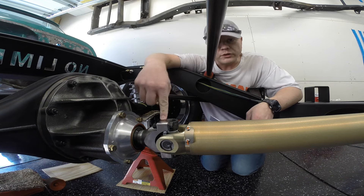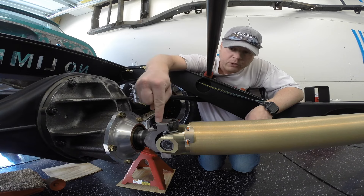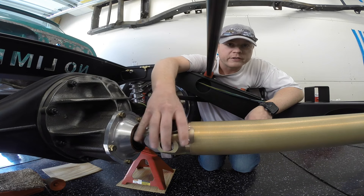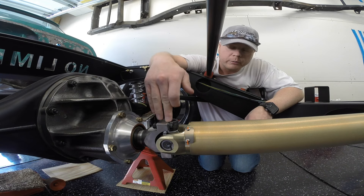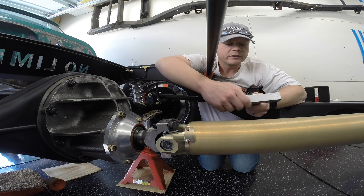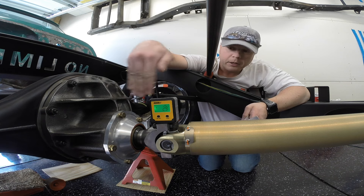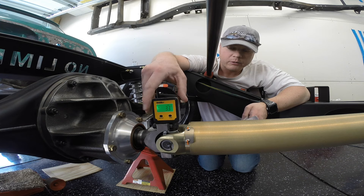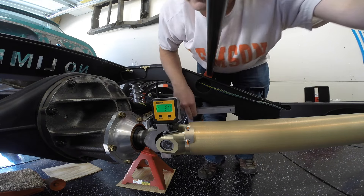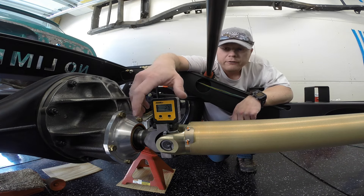The third angle is the angle of the pinion. I've got the driveshaft installed and a big flat surface on the 1350 u-joint, so I can measure right there. If you don't have a nice surface like this, you may need to take the driveshaft off and use the face of the yoke. Make sure the angle finder is in line with the driveline — don't have it cocked sideways. Give it a moment to stabilize, then jot down the third measurement, which is 2.7 degrees. Then we can plug those into an online calculator.